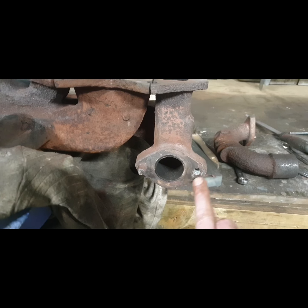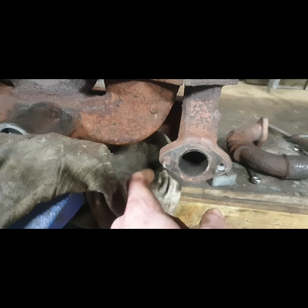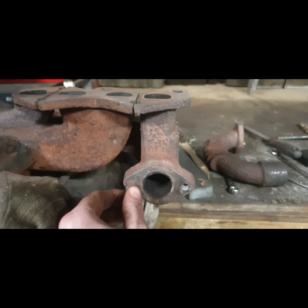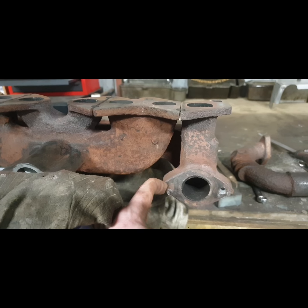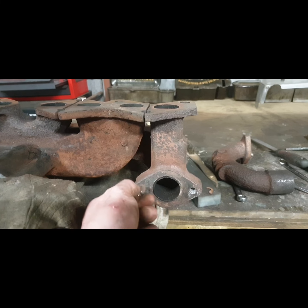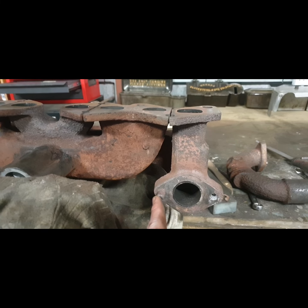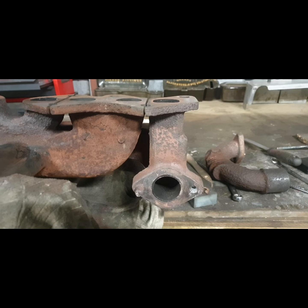I had to take off the original gasket — it was definitely original, fairly well beaten on it. Pity because it was in great nick — metal both sides and a bit of papery stuff in the middle. So the next one on this side, rather than risking ringing it off, I'm just going to cut it off flat with a hacksaw, file it flat, center punch it, and then drill it out.